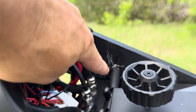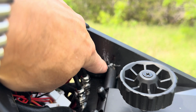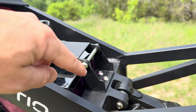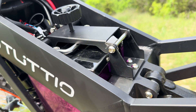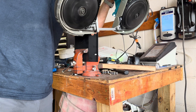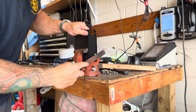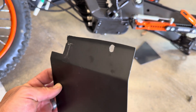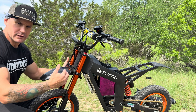Other than that, just taking a file and making this hole a little bit bigger — mine's kind of messy right here, I'm gonna end up powder coating this frame and doing the whole thing again — just making that hole a little bit longer so the clamp can fit in there, and raising up that back clamp is all I had to do to get the battery to fit. One more thing: I had to trim the top of the cover that covers the motor in the front, and notch the side to allow the phase wires to pass through.